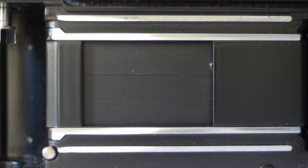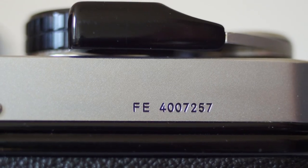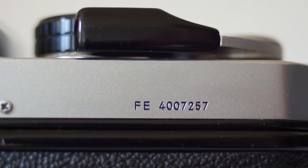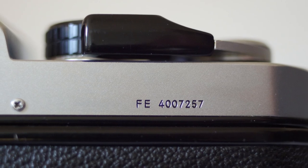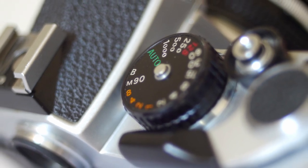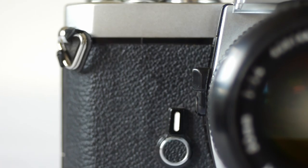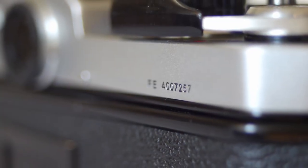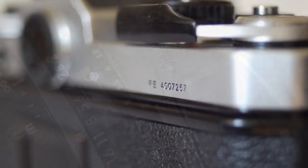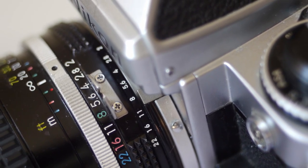Inside, the beautiful engineering continues with a metal shutter made from titanium — an extremely strong and durable material. The FE model, released in 1978, is essentially the same camera as the FM with the addition of aperture priority auto exposure. I like aperture priority and I use it a lot, but it does mean that unlike the Nikon FM with its mechanical shutter, the electronic shutter of the FE won't fire without batteries, except at the M90 setting which gives 1/90th of a second. In all other respects it's the same as the FM, mounting the same massive range of lenses and featuring the same high quality engineering with a dual aluminum chassis, ball bearings throughout, and case-hardened metal gears.